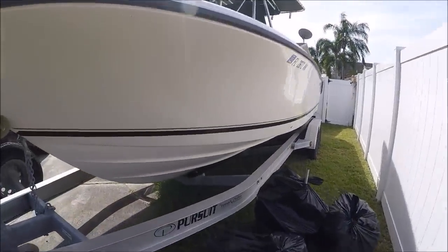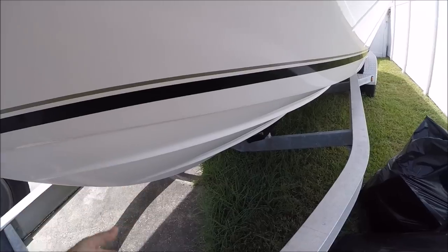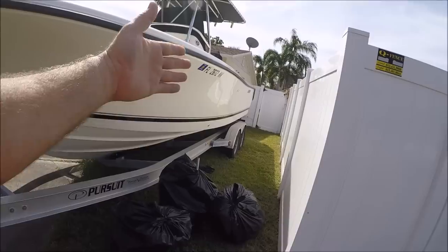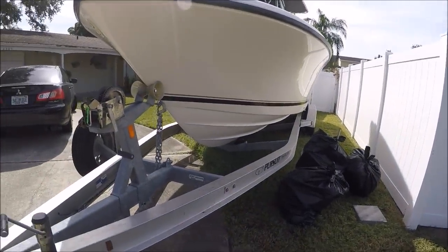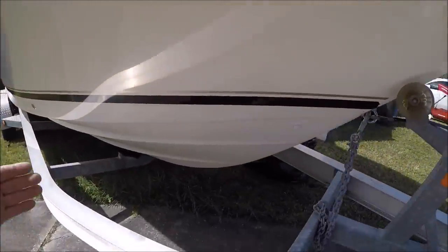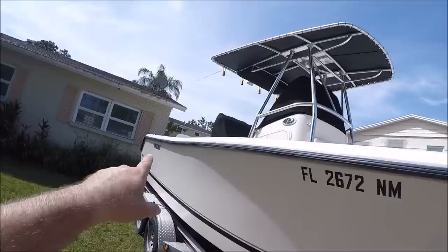I usually don't take care of a lot below the main hull line. I didn't have any muriatic acid with me before, which is why I didn't remove that stain. It's almost impossible to get rid of a really nasty scum line soaked into gel coat without muriatic acid. Since I had it this time, and he did mention the scum line was below the main hull line, I wiped it all down with muriatic acid and removed that big spot in the back.